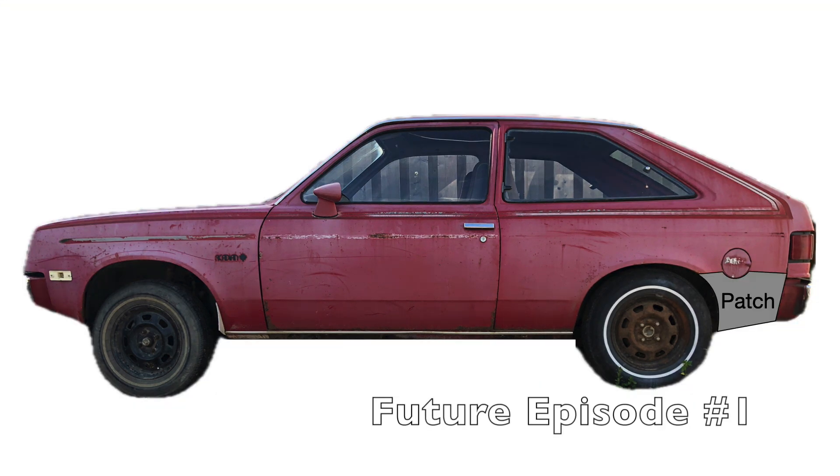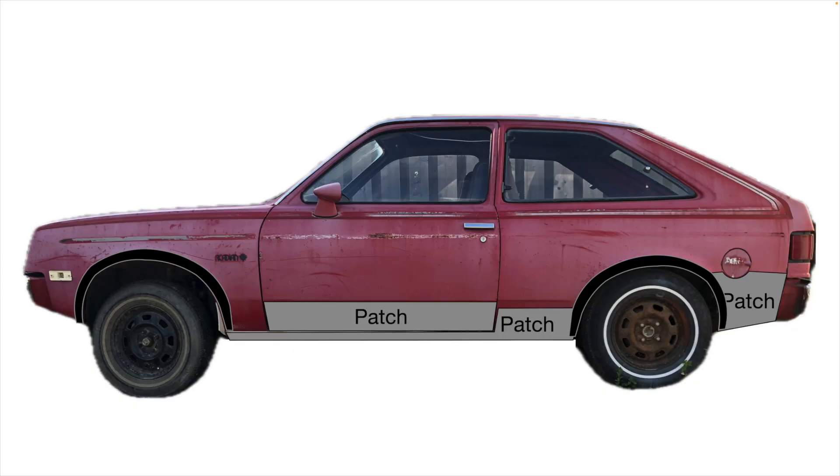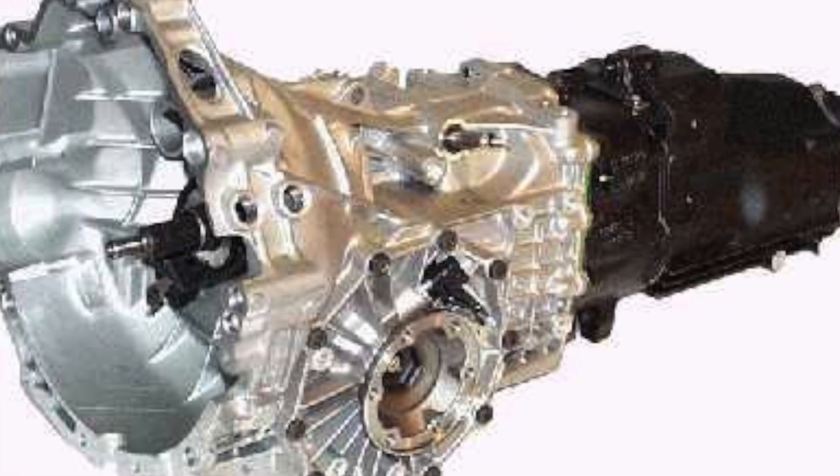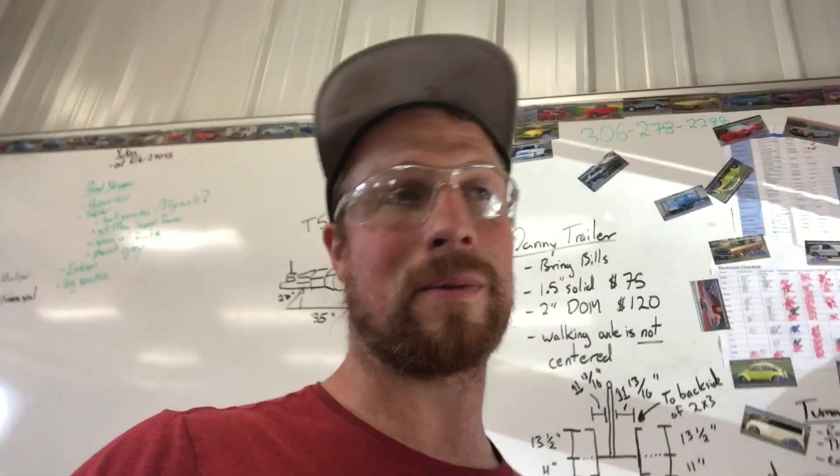Here's the game plan: first we make the car a decent chassis, put the suspension under the car just as a roller, then make it mid-engine rear-wheel drive — that's the first iteration. Now you may be asking where the all-wheel drive part comes in. There's a more common 01E transmission that's all-wheel drive; in fact the version I have is the rarer one. I want to get a 01E all-wheel drive with a transfer case that brings the drivetrain underneath right beside the oil pan towards the front, and at that point I'll be able to hook up a front diff. I feel like this is verging on the impossible task that might explode — but if this video is still up, that means I'm still trying.